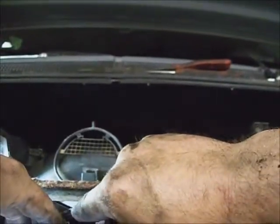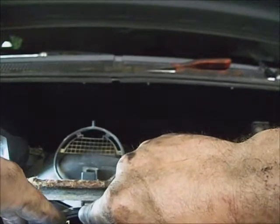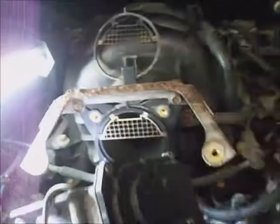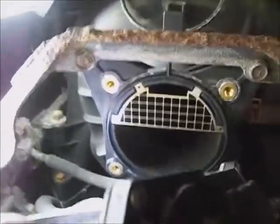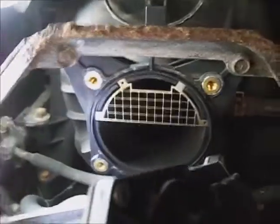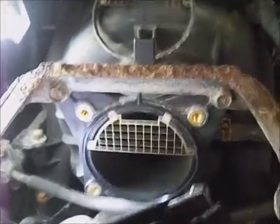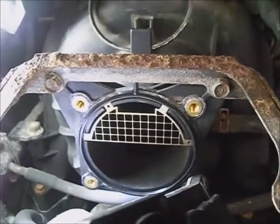And use this top rubber pin as a centering for it all. Just push it in there kind of gradual. The bolts on the throttle body, I'm going to blue Loctite those, and they tighten down to 75 inch-pounds as well. Pretty much all the 10 millimeters on the plastics, 75 inch-pounds.